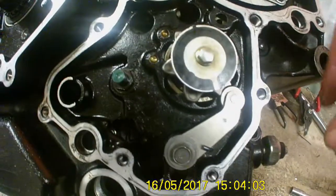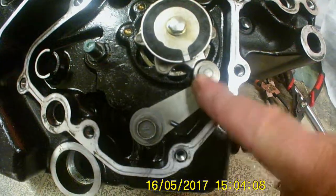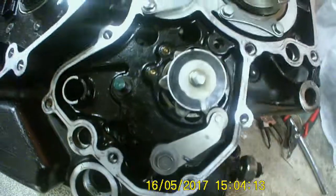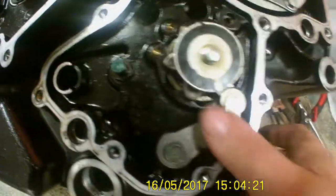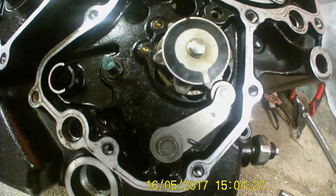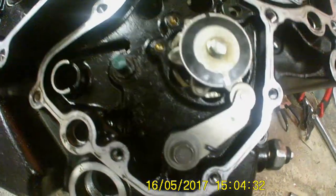So there's the bits I'm going to be putting in now. Now we have it in place — got it so it's tight but not over tight. So it'll still rotate on the springs. Run it through the gears — goes from first, then back up to neutral, and then all the way up to 5th quite easily. So yeah, that's that done.